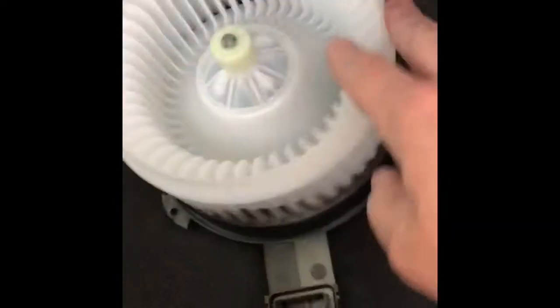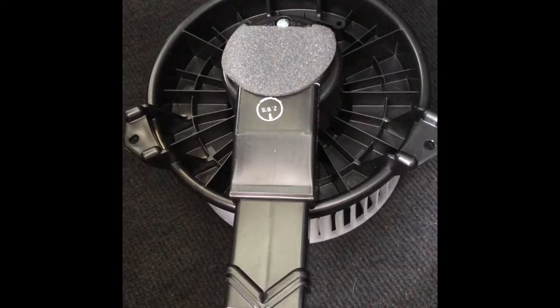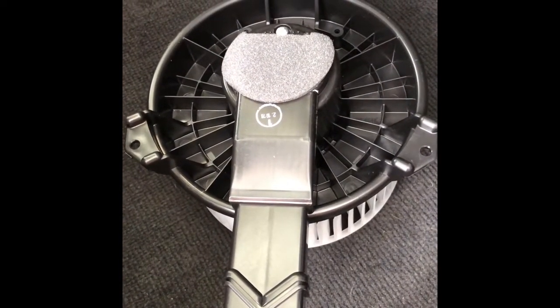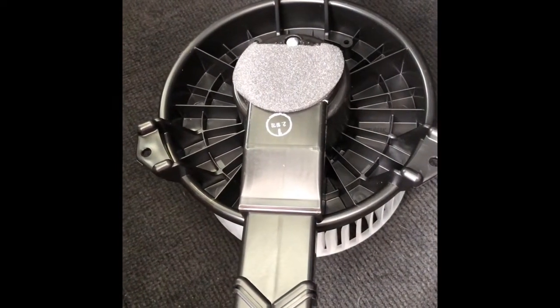Okay, so here is the new blower motor. As you can see, there's really not much to it. It's just the fan that's going to spin, and the bearings wear out, and that's what's making the squeaking noise. Now I've ordered the original Honda part. You can get them cheaper. The aftermarket parts are a little cheaper. For something like this with the bearings, I tend to go with the OEM part, and I can put that link down in the description. It costs around $87 for this piece.